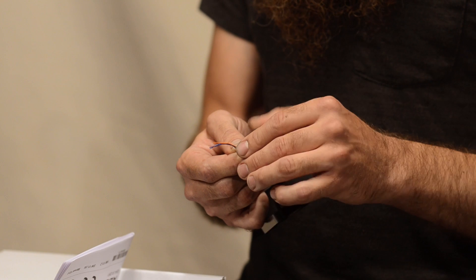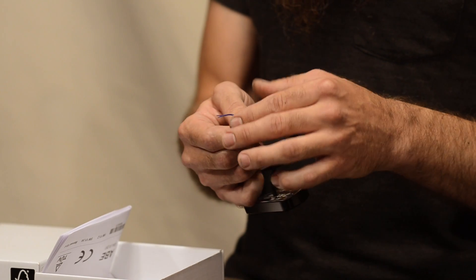The orange wire is a communication wire — similar to a CAN bus communication — that talks with a breakout box, which we'll get to in just a second. This allows you to feed additional information to the gauge for functions that don't have dedicated wires. The last two wires, blue and purple, are for fully CAN bus-enabled motorcycles like a BMW R9T or modern Triumphs with an M-Tri system. For most applications, you're not going to use either of those — just clip them short, make sure they don't contact anything, and leave it at that.